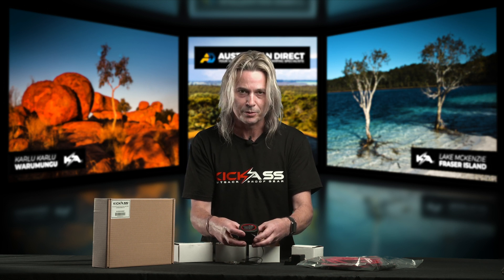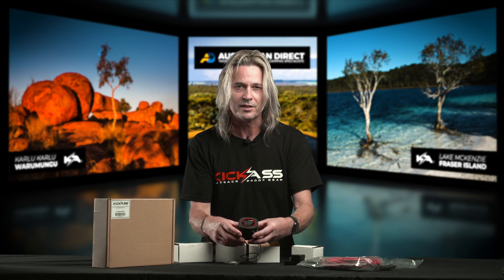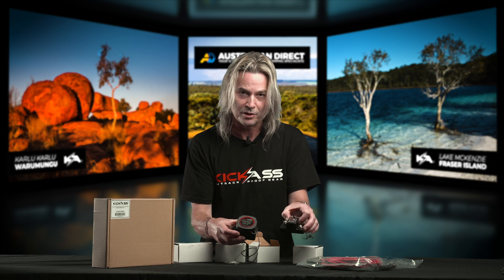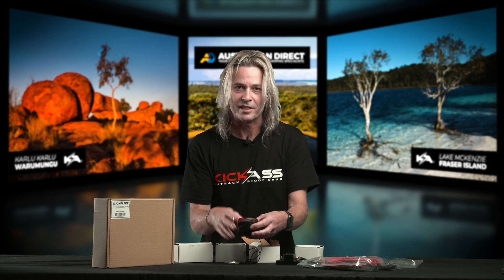For your newer style stuff you really do want a DC-DC charger, but this will handle bigger current draws. Especially if you're using boats with high current draws or something with a couple of fridges that'll pull more amperage through, the 140 amp is basically the same as the little mini brother — it can just handle a little bit more current and does exactly the same job.